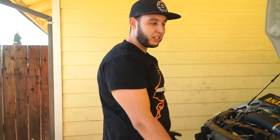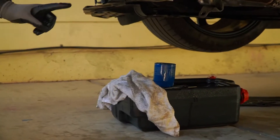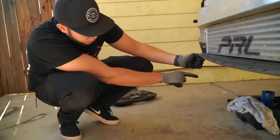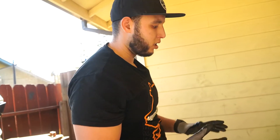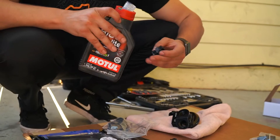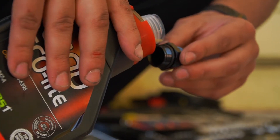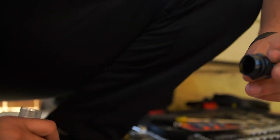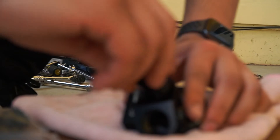First thing first - how I said, you remove your bumper. Then first thing you do, you go under the car and you remove your oil filter. As you guys can see I already removed my oil filter. Make sure you put something under it because it's going to have some oil. So you remove your oil filter, then after that we're going to come back here and do some drilling. I'll show you guys the process so you can install it yourself. We're going to use this adapter. What we're going to do is put a little engine oil on it - I'm just going to put a little bit on the threads.